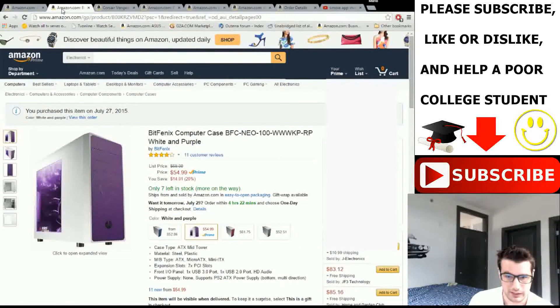For the case I went with a BitFenix case — it's a girl's case, that's the reason I went with it, but you can absolutely go with any case. The case does not matter whatsoever. If you're going professional and want better airflow, or if you're overclocking, then yes the case becomes a factor. But with a low-budget build like this where you're not overclocking, airflow for these components is not going to need anything substantial to keep them cool.